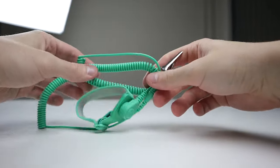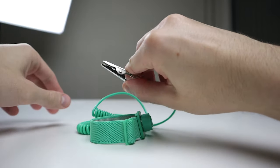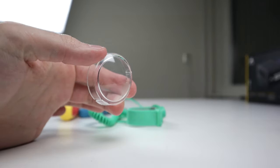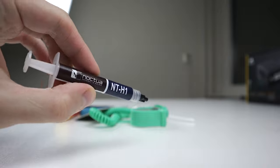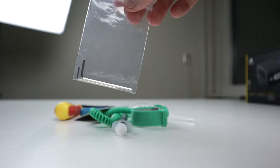Alright, let's start. First, here are a couple of things you'll need: an anti-static bracelet connected to a grounded source, a couple of pliers, a Phillips screwdriver, a small plastic cup to keep all the screws, a plastic card — I use my gym card, but I never actually go to the gym. Some thermal paste — we use Noctua's NT-H1. Great stuff, I pretty much use it for all my builds. And they included hex keys.